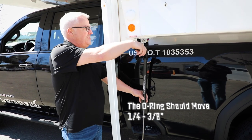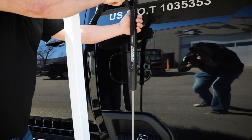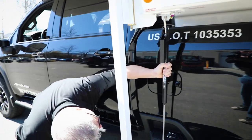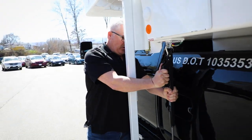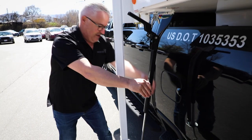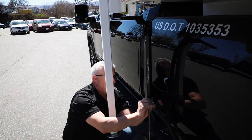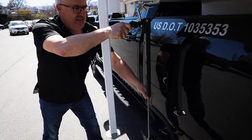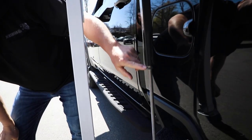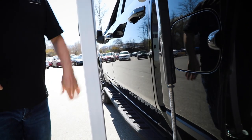Let's just see what we have here with this one right now. I'm just going to push this down and if you look right here you'll see it moving. I'm going to flex it a little bit — it moves, and I might have it just a little bit tight. So I'm going to release it, turn this back one revolution, put it back in again, adjust the o-ring so that it's up nice and flush so I get my measurement, and snap this down into place — that's perfect. That's how you know that you have it tensioned correctly.